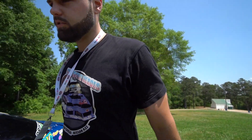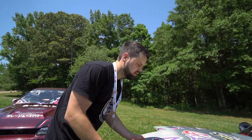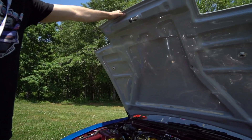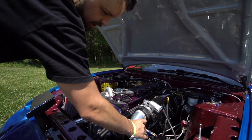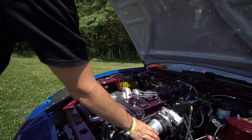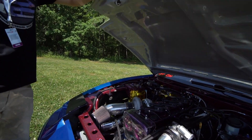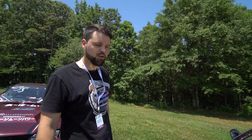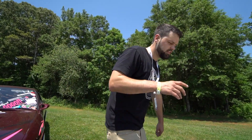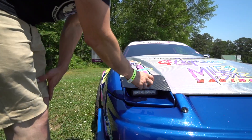As far as the engine bay goes, this is the 2JZ built non-VVTi. It has a BorgWarner SX-E 363 on it. The LPS Alpha Locks are on every coupler, so no silicone couplers — you never have to worry about blowing one of those out. I still believe we are the only drift car with this system. Global Time Attack is out here this weekend at Road Atlanta, so it's sweet to hear those race cars. This is an OriginLab type front bumper tube on it, and these are some custom-made headlights with carbon fiber eyelets I cut out myself.